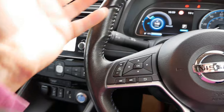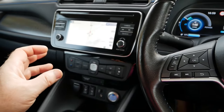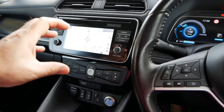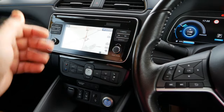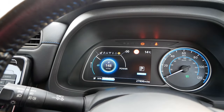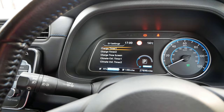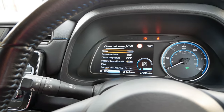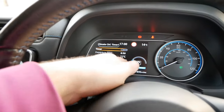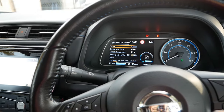Pre-condition while connected to the charger, then in the car turn the heating off completely and use your heated seats and heated steering wheel — heating your hands and your back genuinely keeps you warm. Pre-conditioning also works in summer, putting the air conditioning on to cool the vehicle down before you get in. To access pre-conditioning settings, use the menu buttons, go to Settings — the furthest right — then EV Settings, and you'll find Climate Control Timer. Set the days and time, typically Monday to Friday at your departure time. In the same screen you'll find charge timers, which is where you schedule overnight charging to match a cheap-rate tariff like Octopus Go.